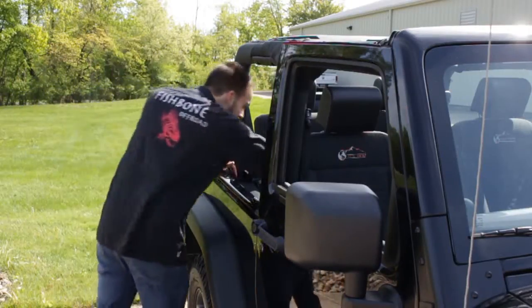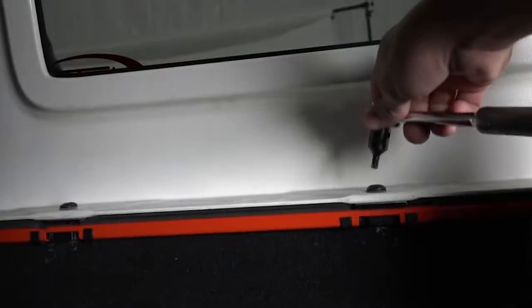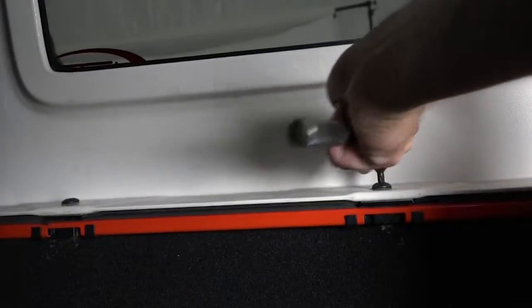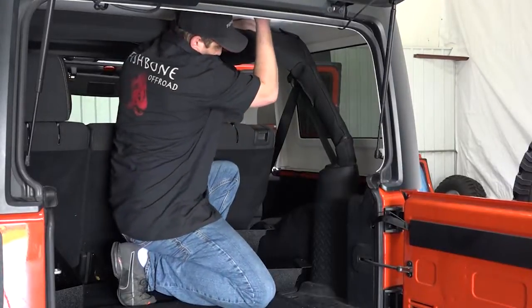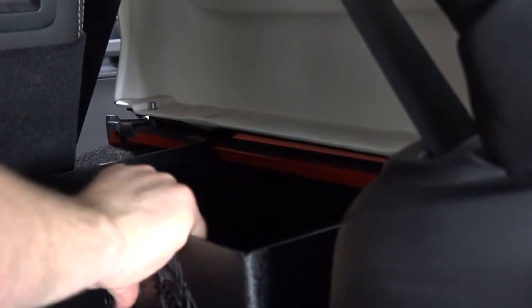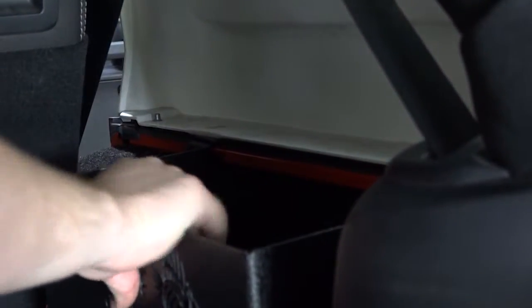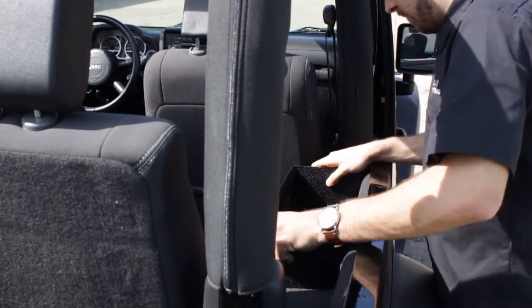If you have nut plates, simply place the appropriate bin over the inner two tub rail bolt holes. If your hardtop is on, first remove the inner two T40 Torx bolts. Lift the top with one hand and slide the bin in between the tub rail and the plastic with the other. For soft top models, with the top on or off, place the bin over the inner two bolt holes.